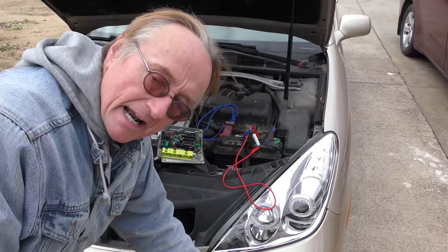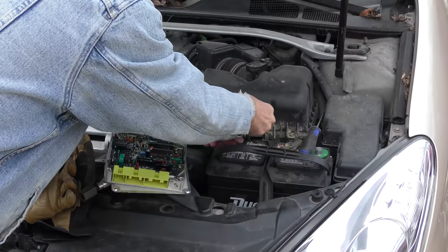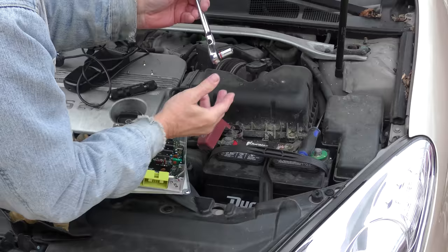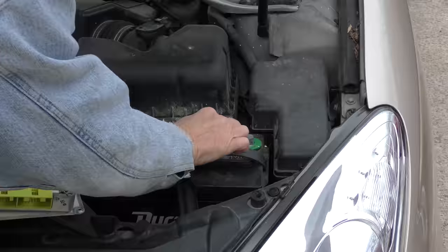Don't freak out with many modern cars when you're done doing this. Take everything off, put the terminals back on — put the positive on first, tighten it up nice and snug, then put the negative one back on and get it nice and tight. Once you do this, you might have to reset your radio stations and your clock. And in some cars, especially Toyotas, they'll idle a little bit odd for a few days or maybe a few hours because the computer has to relearn to idle. You might see it shaking a little too much at idle — just drive it around, it'll reset itself and get used to driving.